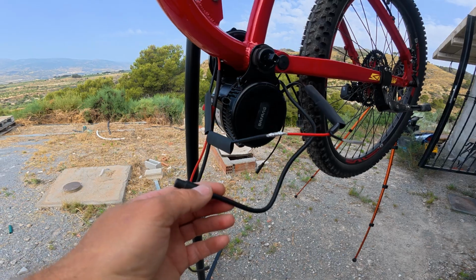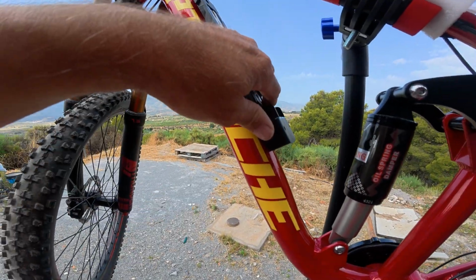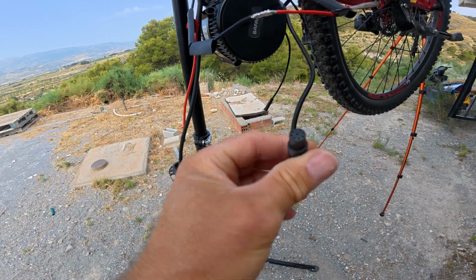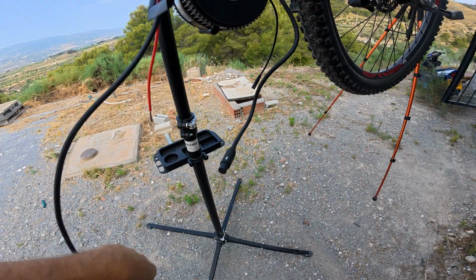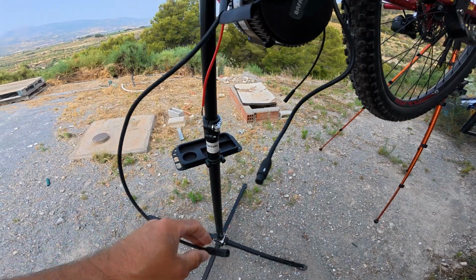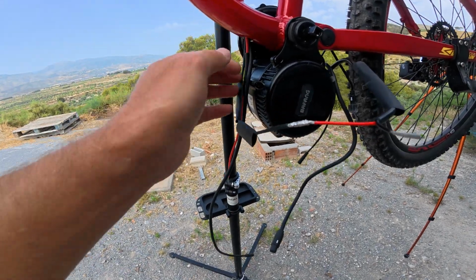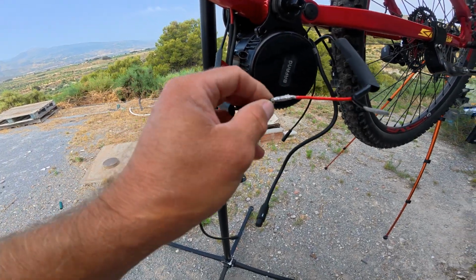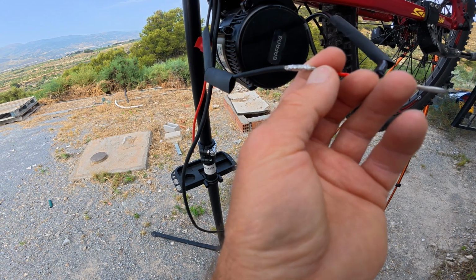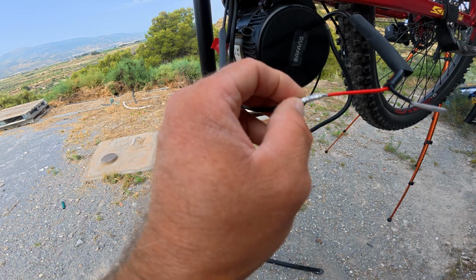So what we're going to have to do is, I love this, start going backwards on the project, take this off again, pull the wires all the way out, do this cable, connect this cable here to this one, which is slightly damaged. We'll trim that rubber off and get some shrink wrap on it, feed it back through, and then bring these cables back through from above back into here and then solder them. Now, only one good thing I suppose is that I can cut this cable here, this side of the solder, get a bit of fishing line on there as I draw it back through, and I can use the fishing line as a draw cord afterwards.